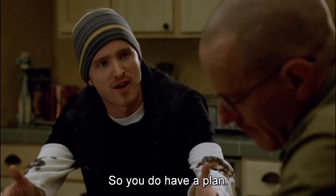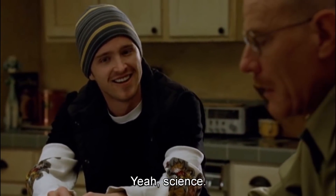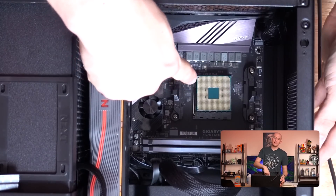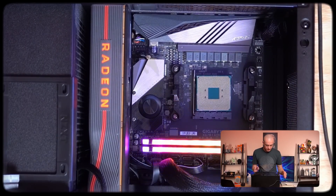I have a false sense of security going into this project. I don't think I'm gonna destroy my 3950X. If I do - science. Yeah, science. Let's go ahead and turn this on. You can see the 3700X is right there - no mounting pressure, but everything's turning on. The thought behind this is that the integrated heat spreader on the 3700X will be able to dissipate some of the heat coming off of the 3950X.